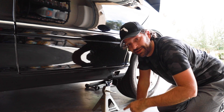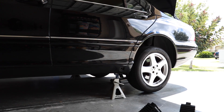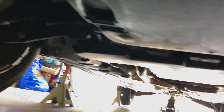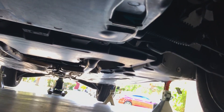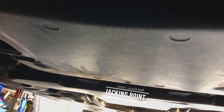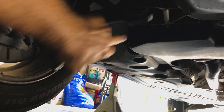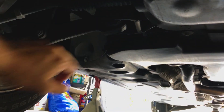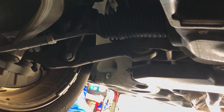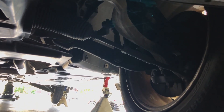Now that the car is safely up in the air, I can start working on it. While you're underneath the car, there are certain places where you cannot jack. If it's protected by any type of plastic, there's probably something underneath that's too soft, like an oil pan or a transmission oil pan — those are points I would not want to lift a car. Anything that looks like solid metal, you can lift it. There are several lift points on the vehicle, and if that's your only point, you're going to have to go for it.